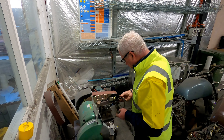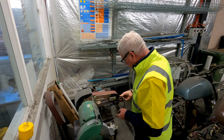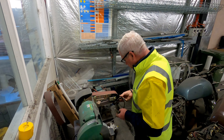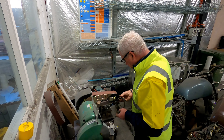I've taken the burrs off, and what I'll do is — this is the side that you can see is profiled pretty badly from banging into the basket. That's the torque side of the clutch. I'll flip these over so that the smoother edge is on the driving side, and that'll buy him a little bit more time anyway.